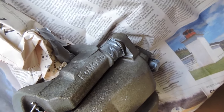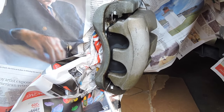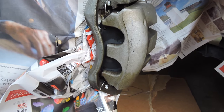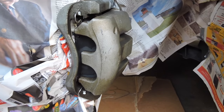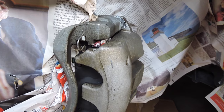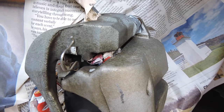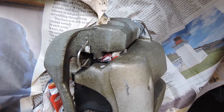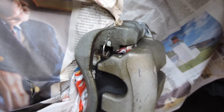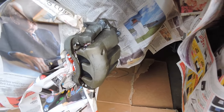I'm just trying to be safe, because those are brake parts — they're supposed to be rubber, and who knows what paint can do to them. As far as the brake pad, painting it red isn't going to hurt it unless you don't want it red, in which case you could take the brake pad out. I always leave it in though. Also remember that even in between these little tiny spaces there are little parts of rotors that show, so try to shove any little papers in there to make sure the rotor doesn't get painted. I did clean them with the brush and brake cleaner.